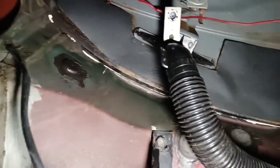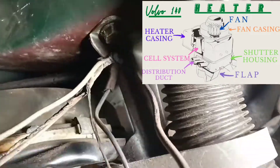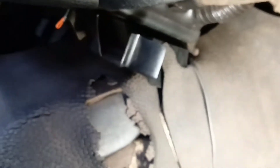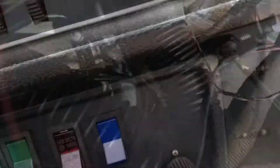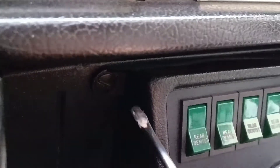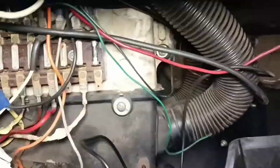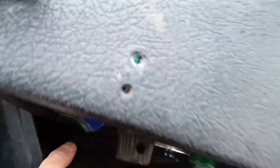Now we get good working access and can look under the dashboard. We look in here with help of a cell phone only, and we can see our heater. A lot of wires. We also need to open the central console: two rotated plastic screws, two plastic locks, and steel clips for reaching under the plastic trim. Disconnect the air hoses for convenient work.